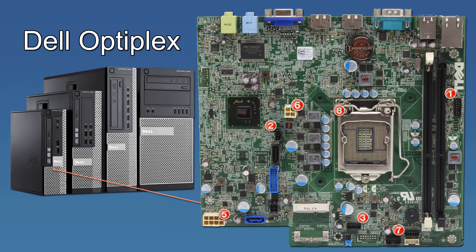All is not golden when you see YouTube channels making videos on these old systems. A lot of eBay sellers selling these computers have botched them together, and you could end up buying what is basically the innards of one of these systems bunged into another case. Be prepared for a headache, because a lot of these connectors have sensors on the board which need to be connected, otherwise you'll get error codes and messages. There are ways to trick the board, but disabling sensors and finding pin layouts is a lot more work than just building a computer.